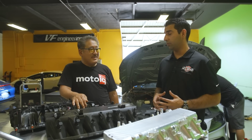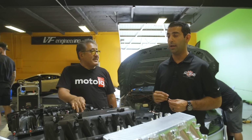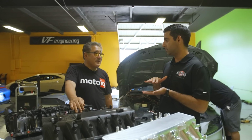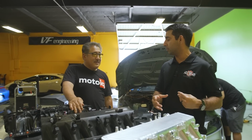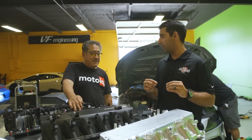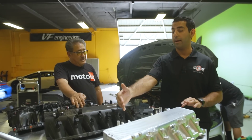And if you get into the nitty-gritty details of what the core is, yes, I said it's a bar and plate core, it's got 12 rows, but we can talk about the super short fin height that we're using. We're using a 2 millimeter water channel, and we're using a 5 millimeter, or 4.83 millimeter to be exact, air channel. So those shorter fins, more dense, gives you more surface area to dissipate the heat, which allows you to get more rows of cooling in terms of water flowing through the core, which ultimately brings down your intake air temperatures. So, we really sat down, Nick and I, and talked about every single component, whether it's the brazing sheet thickness, whether it's the fin height, the fin thicknesses, the bar, the spacing for the divider in the back, also even these front and back plates of the core.